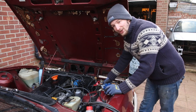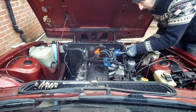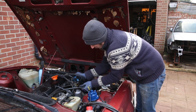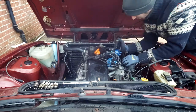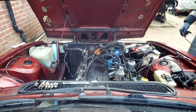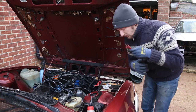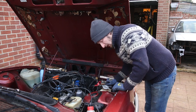I got halfway through replacing all my HT leads and forgot about something, so let's do that again — maybe with less fail this time. With the old distributor cap off, I'm just going to copy the numbering layout of all the leads that are on it onto the new one. The new boot just isn't quite big enough to fit over the old coil, so I'll reuse the old one. That should be all good, and we'll match those up on the other side.